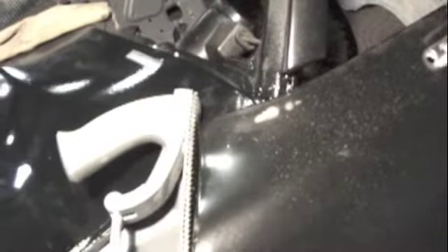These are adjustable files so you get a real nice even look to it. Now on the other side that we haven't started on yet — I started filing down on the bottom and got the point and the roll off the corner. If you take the file and stand it up and look across here, you end up with that much of a gap difference. You're going to follow it and straighten it up — file off the corner. It's probably an eighth inch down in there — shows you that gap difference. The corner goes to a point, it needs to be filed off. If I have to tack weld it back I will. Both corners just need to be shaped up, tacked, and everything so it'll be lined up.